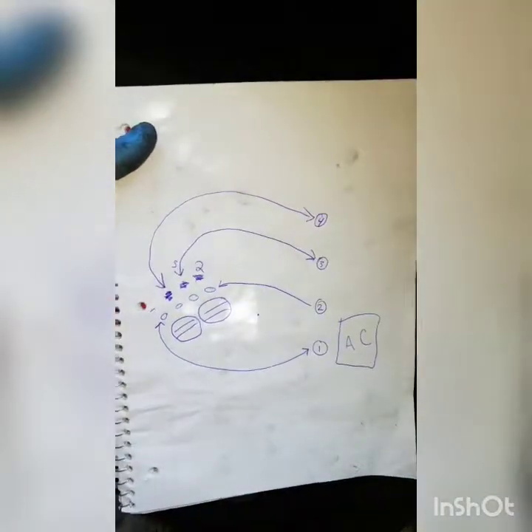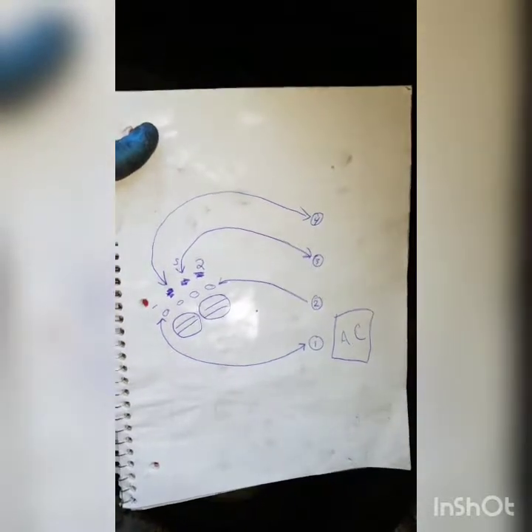There's the diagram. Here's another tip — if you don't have an aerosol can to clean around the spark plug, grab a long hose, get a little stick to loosen up the dirt, stick it in there, and just blow. That's it — it's easy, you don't have to take any of this stuff out.